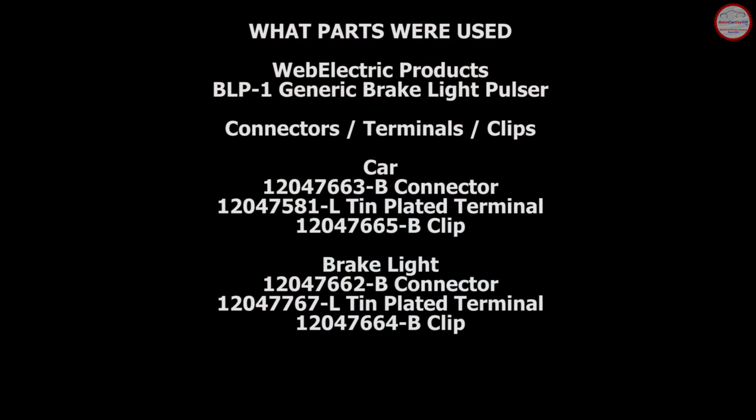Of course, the main component was the Webb Electric Products BLP-1 generic brake light pulsar. I've purchased units from that company over the last decade or so and I've had no problems, so I highly recommend them. If you wish to install a different brake light pulsar, of course the wiring may change a little bit, but the general concept is the same. And the connectors that are necessary to adapt any module into the third brake light you can see on the screen as well. I purchased those from terminalandconnectors.com back in 2015, and I was able to purchase them in small quantities. So if you choose to do this project, you should be able to obtain them from there or any other source on the internet that sells them.